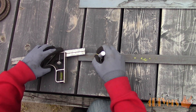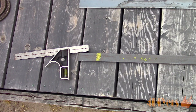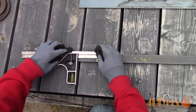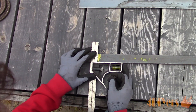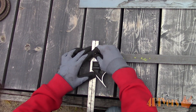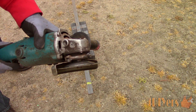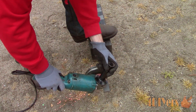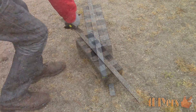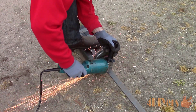Starting with the main bracket on the radiator support — I originally planned on having full height vertical portions but instead decided to make the horizontal portion continue the full width of the bracket so I can install the fasteners directly into that piece. If by any chance the welds did fail there will still be fasteners holding the bracket. I am using a square to ensure my cuts are accurate, making rough markings with a paint marker and then using a scriber for the exact dimension. If you are a beginner welder this is certainly a great project to help perfect your skills. Ideally a cutoff saw is best for squareness but instead I'm using an angle grinder with a cutoff disc.